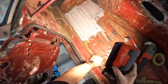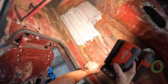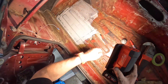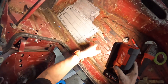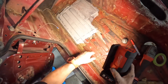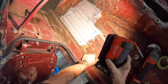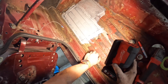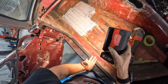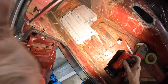I got better towards the end. I watched a lot of YouTube videos — very good instructional stuff about how to do this. Some people do four spots at a time, others do one spot at a time, tack things in, grind it, bash it, then fill and paint. This is a floor pan, so it's not super visible — not that that's any excuse to do a worse job — but I'm happy with it.